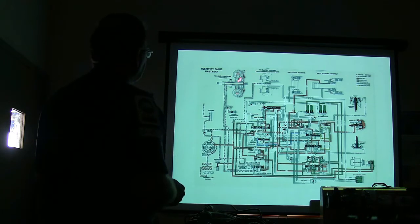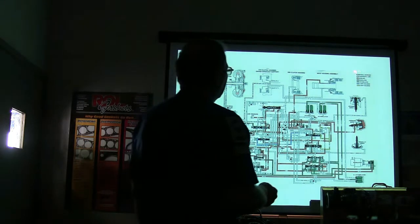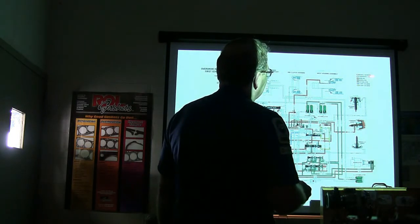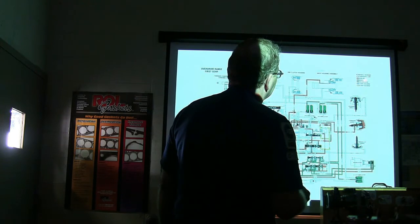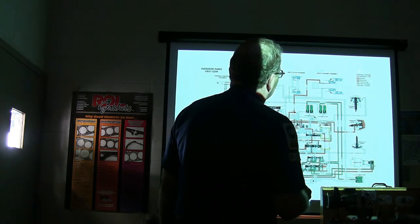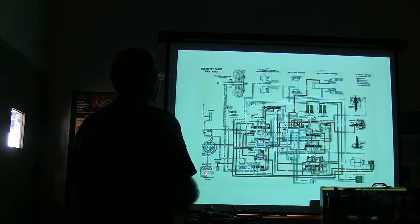What do you see here? There's a torque converter. That's not too hard. Now look up here. See that? Converter and lube. That's basically the pressure you got. Mainline pressure. Intake and decrease. Modulator, accumulator. In other words, intake and decrease is where it pulls fluid out of the sump. See the stripes? So you got suction pressure here pulling this.